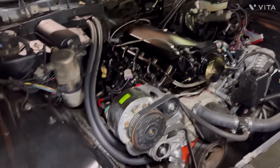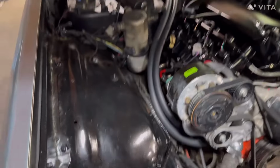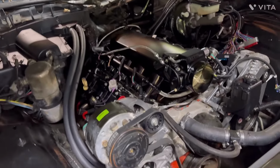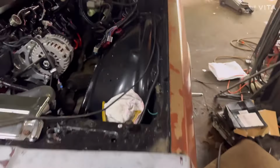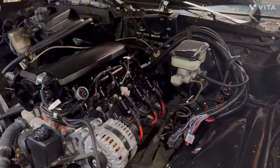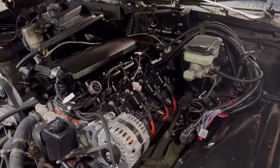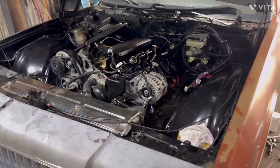All right, people, we closing out, man. We got a good little bit done today. Kid got me wired up. Starter cable, starter, wire harness. What we got left is vacuum line. I gotta get the correct MAP sensor. That MAP sensor is not plugging into the plug on the wire harness. But yeah, that's where we at.